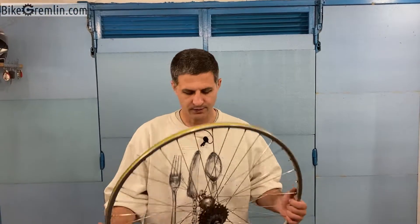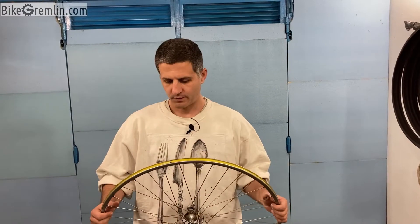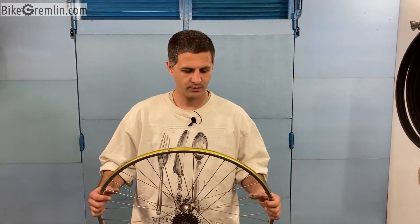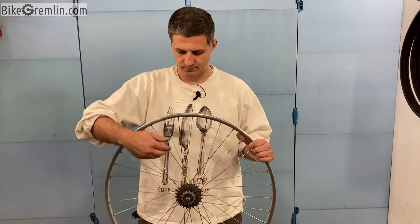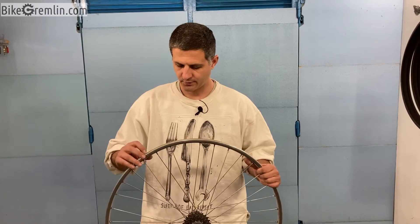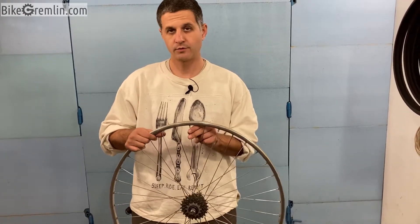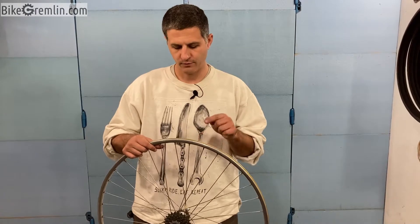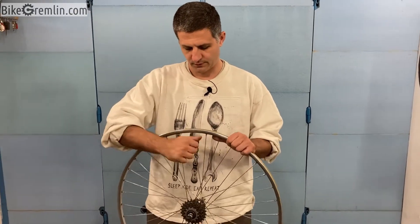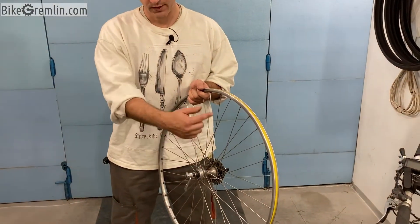There's some debate about bicycle spokes — I found it on DT Swiss's website — that they break because of too much load. It is my theoretical knowledge and experience that spokes usually break because of material fatigue, not because they get too much load, unless physically damaged. The basis of that is that spokes can take a lot more load and tension than either the rim or the hub can take — one of those would break first. If you use too much tension, you are very likely to have hub flanges crack, especially on a radially laced wheel.